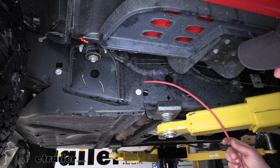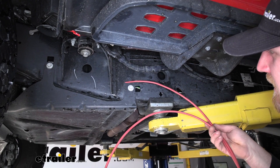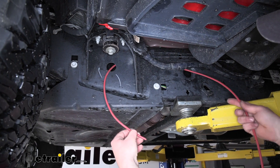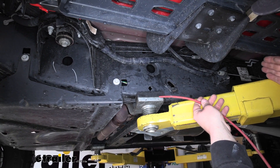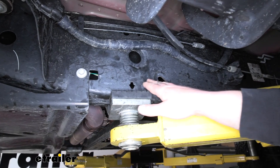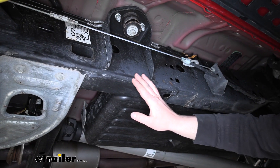I used a five or six foot piece of nylon air tubing as the pull wire — you could use a coat hanger or another thick piece of wire. I'd find a larger opening in the frame, run the wire forward, tape our diode wiring to the end of the pull wire, pull it through, bring it out the other side, and repeat that process all the way along the frame rail. That makes it much easier than trying to naturally fish it all the way back. The wiring is protected inside the frame rail, which is especially important with this Raptor in case the customer decides to take it off-roading.